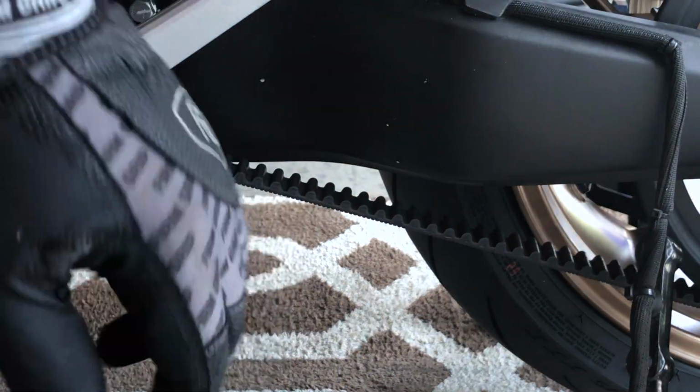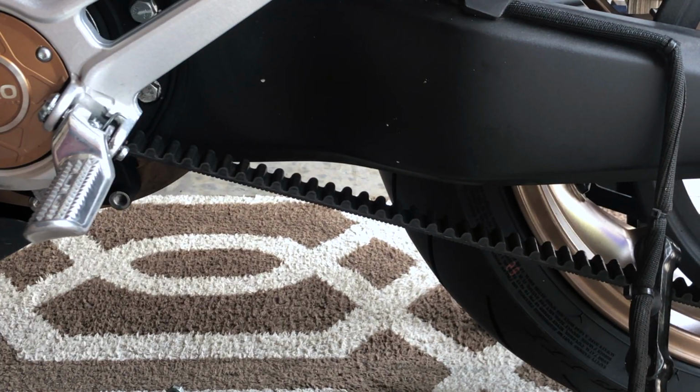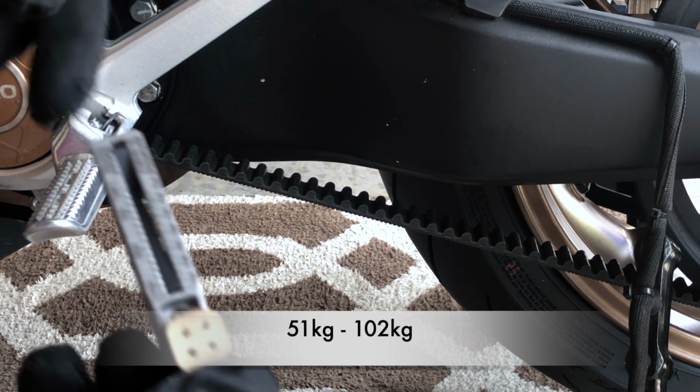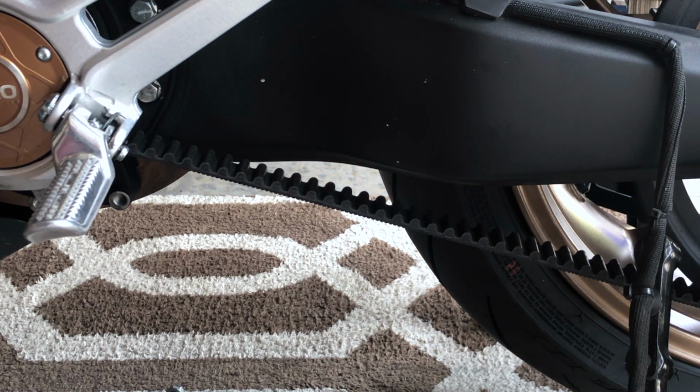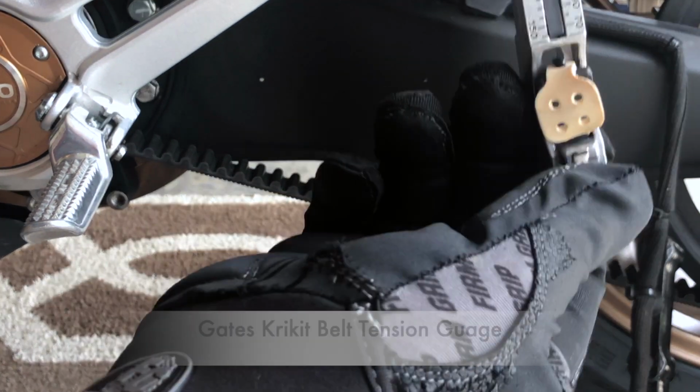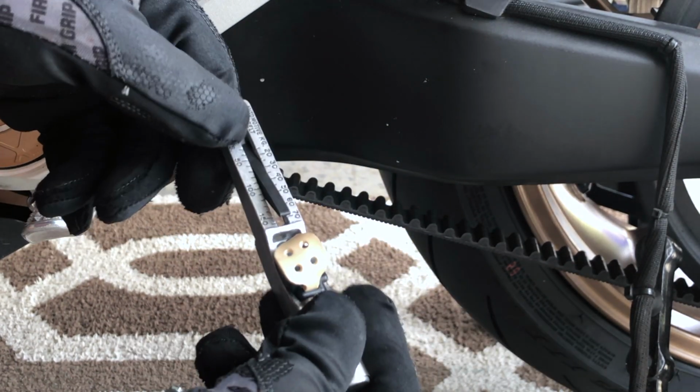The belt tension feels pretty close to how it usually feels. But I'm going to get scientific here. Zero recommends that the belt tension be at least 51 kilograms, 51 to about 100, I believe. So they also talk about some app that you pluck the belt with a wrench and listen to the frequency of it to determine tension. Personally, I prefer to use a Krikit like this. So you can order these on Amazon. I'll post a link below.